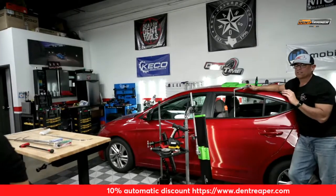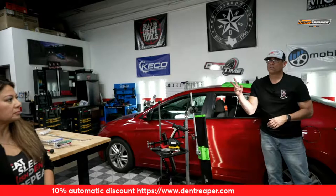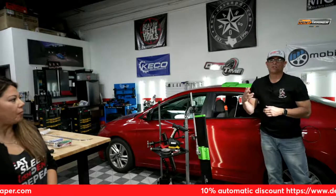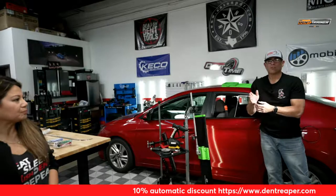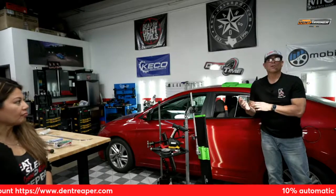Okay. Listen, guys, here's the deal. PDR is like a relay, but not a race. You've got your soft tip, you've got your midpoint, and you've got your sharp. Generally, when you get much better, you usually use one or two tools. Meaning if you have a soft tip version where you can screw on your tips, you can switch those tips. But when you get really good, you could probably start and finish it with a Reaper rod or a Door Lord sharp or PDR finesse or something like that.